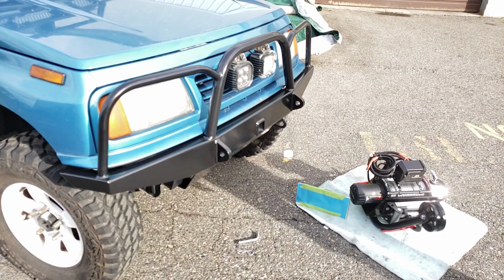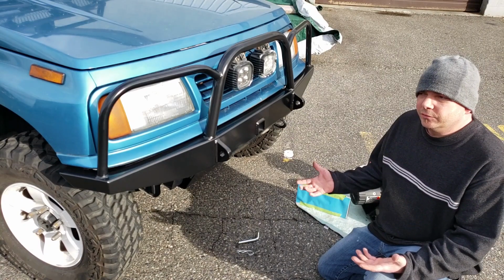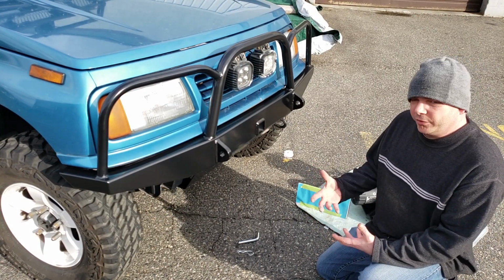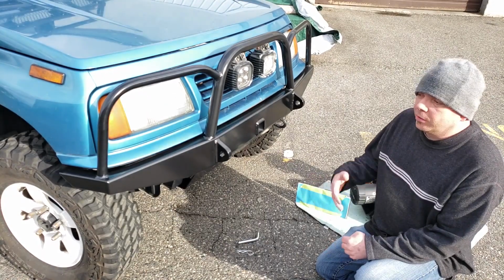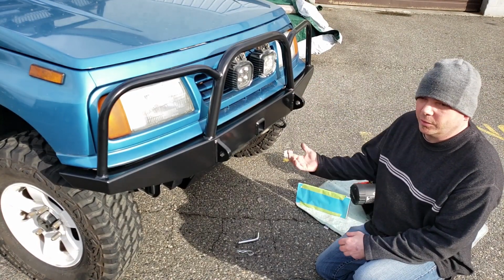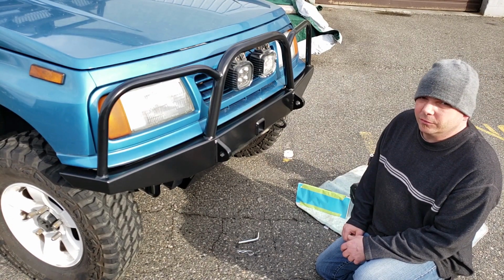and there we are. Now, generally speaking, the winches that I recommend for these are 4,500 pound winches, which only weigh about 30 pounds. With the winch cradle as well, you're up to about 50 pounds, so it's really quite easy for one person to handle. Not a problem at all, and it's enough winching power to get one of these things out in a bind, and it's enough winching power for winching game up onto the vehicle as well in most cases.